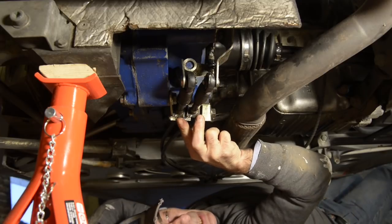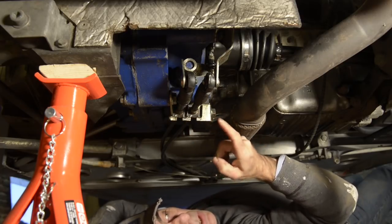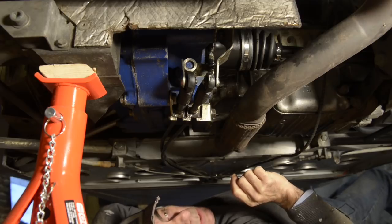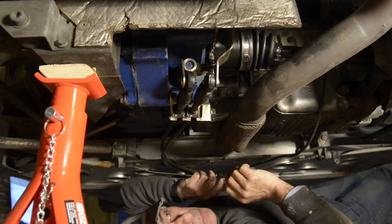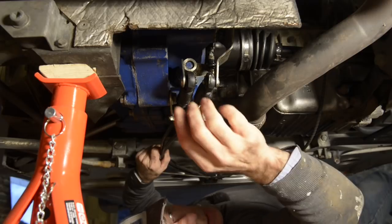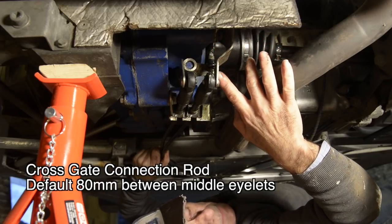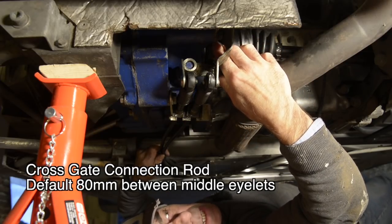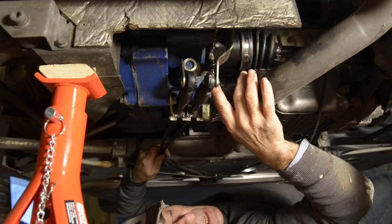In terms of adjustments — and we're not talking about adjustments right now — this bracket here holds the two cable clips in place. The only adjustment you can do is by undoing and redoing this nut. If you look closely these slots allow you to move the bracket a bit back and forward, but not very much. The cables are made to length so it should be okay, but that's all for the adjustment video. Also, this connection rod here is only used for the cross gate operation and has to be aligned to about 80 millimeters — also a subject for the adjustment video.